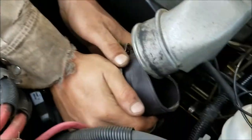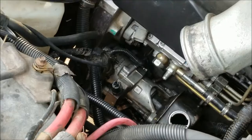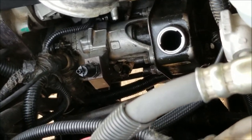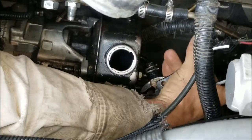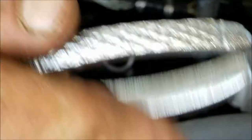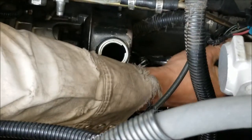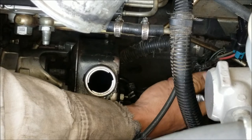You can just flip that up and it will come off, then pull this off. Take it right here, go down with it, bring it back up and it comes out — and that is out of your way. Proceed to the next step: grab preferably channel locks but pliers will work. You want something to catch the fluid down there — have a pan ready. Those are just squeeze clamps and you can use pliers to get those off.